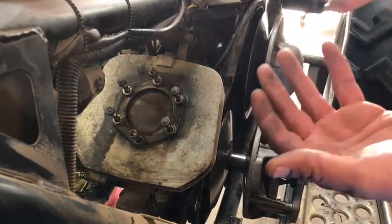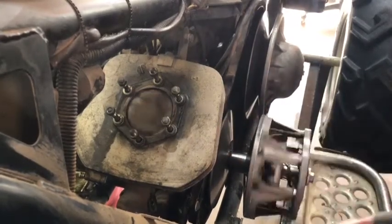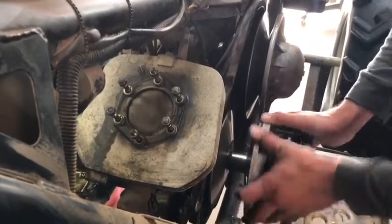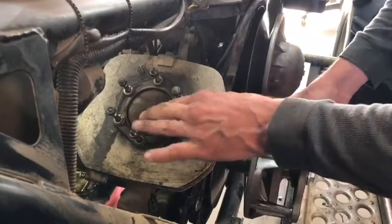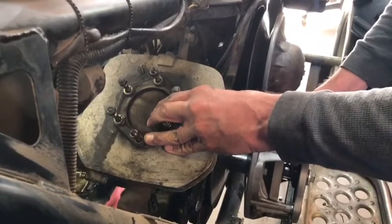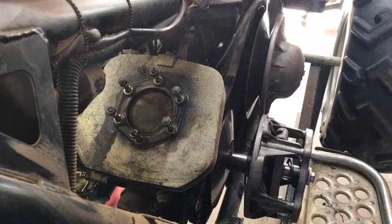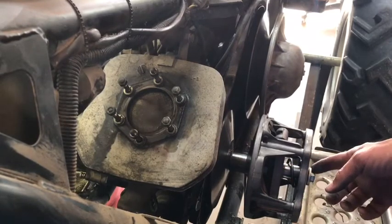If you're bothered, wear gloves — I'm not going to bother wearing gloves, obviously. So, that leaves us with our primary clutch to take off. You can feel a lot of roughness in that. Hear that? That's a play in the connecting rod and wrist pin and crank pin. That motor is pretty well done for. So I'm going to get a ratchet, take the clutch bolt out, and then we'll have to use a puller on the rest of it.